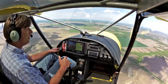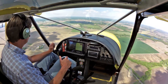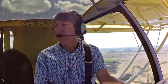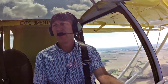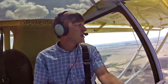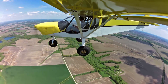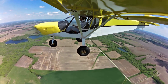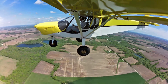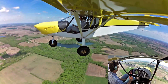Different engines you could use for the 750s — the Jabiru, the Rotax, UL Power. Vikings have become real popular. William Wynne's Corvair engine. Continental O-200, O-235. It really depends on what your mission is for the aircraft or what kind of budget you're on. You want to find something that works best for you — don't decide based on what everybody else is doing. If you just want to get up in the air and go sightseeing, taking off from airports and not going into short strips, then you don't need a high-performance engine. An O-200 Continental will work just fine. I've probably got over a thousand hours with the O-200 and the 750 — I thought it was the greatest thing until you go to the next lighter engine with a lot of horsepower. But there was nothing wrong with it at all.